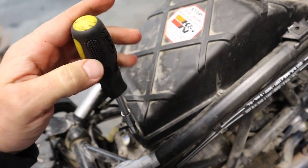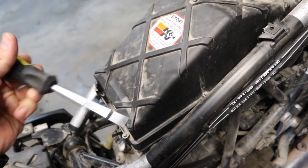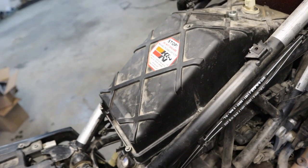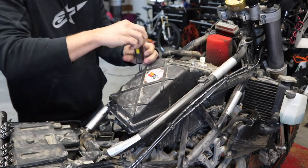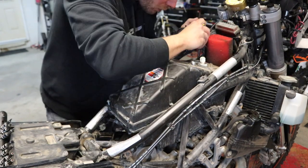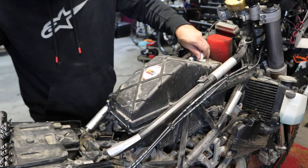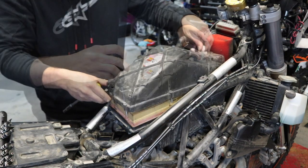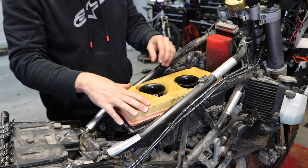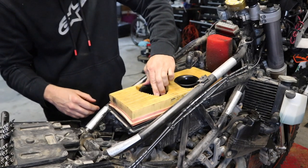If we take a look around the top of the air box, we have a bunch of six millimeter screws we need to remove. You could use a flat blade on them, but I'm going to use a six millimeter socket and get all these removed so we can pop the top of this box off. With all those loosened we should be able to pop the top of this box off. Despite what the top of that air box said, this does not have a K&N in it — it's just got a factory filter.